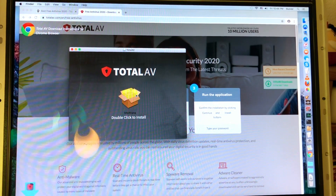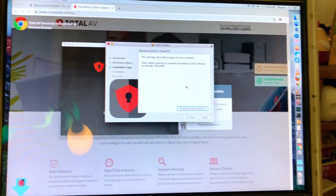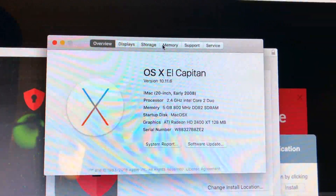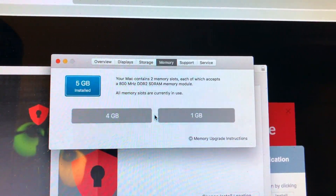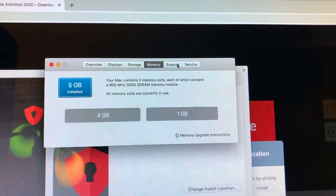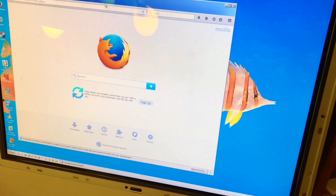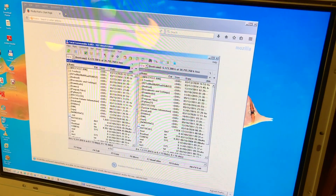It worked just fine! I'm gonna install some antivirus software. The speed is pretty fast — much faster than the regular hard drive before. It's an early 2008 model with 5 GB RAM. Officially it supports 4 GB but I installed 5 GB — you can go as high as 6 GB with one 4 GB and one 2 GB slot. I also have Windows XP installed on a separate partition — in Russian actually — and it just flies, it's incredibly fast.